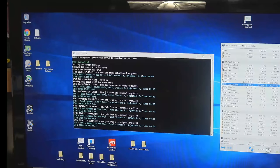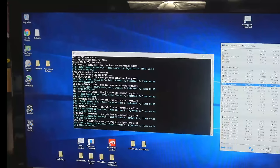I know if you've got 100 cards, you're gonna spend some time, but it's worth the time. You could deploy it to all 100 cards, but you're gonna spend a lot of time pulling cards and fixing stuff, versus going through them once and doing a 10-minute test on each. If it makes it through the 10-minute test, do the next card and work your way through a 6-card rig, get it going, let it run overnight and check it. Make sure it's stable at those rates. You make it through a few nights without any reboots, you're good. So it went from 27.9 to 26.9 just from 75 megahertz on the memory.